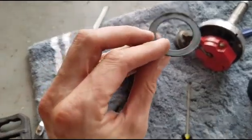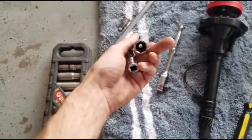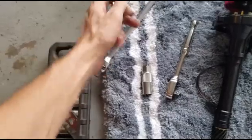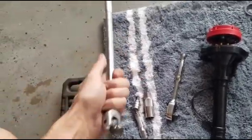Here's the old one - it's kind of like a paper ring. Now to do this, you want a spark plug socket because you're going to have to pull the plug on the number one cylinder. I take a couple extensions with the wobble head - these are snap-ons, great for those tight areas because I put the headers on before I pull the plugs out. You need a breaker bar because you're going to turn the engine over - we're going to have to time it before we drop this distributor in.